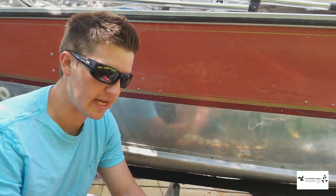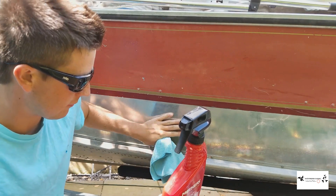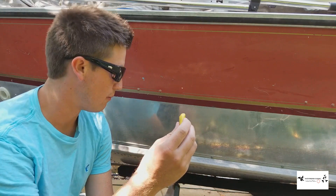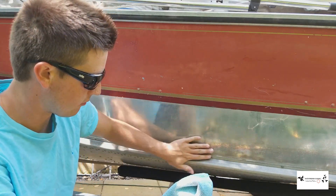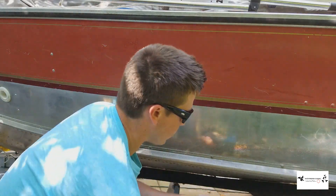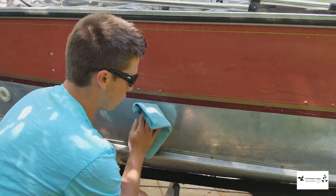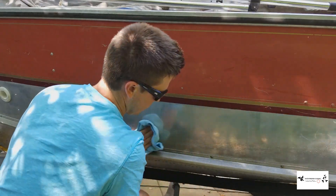First, something I didn't do in my previous video: I'm going to be taking some instant detailer and a microfiber towel to clean off the area, and then I'm going to be using a clay bar to remove any embedded contaminants in the aluminum. It's not really going to remove much, but any stuck dirt will prevent it from getting in my pad and creating more scratches — it'll just help the pad work more effectively. So I'll just swipe it off to get the surface prepped a little more for polishing.